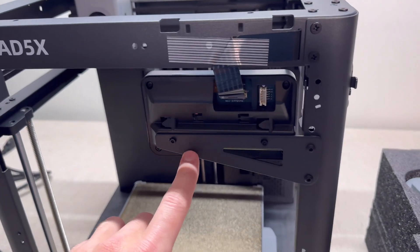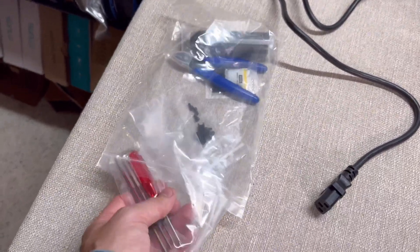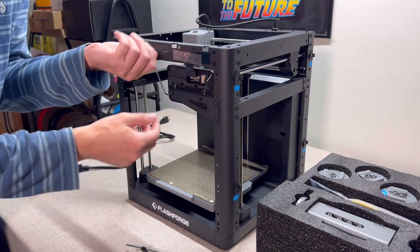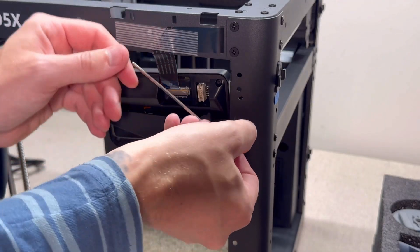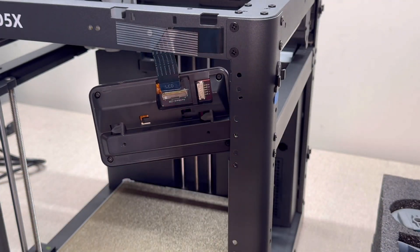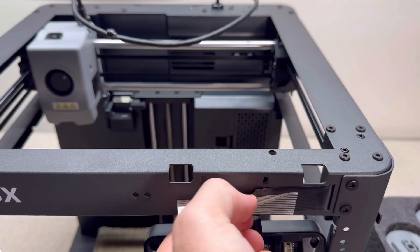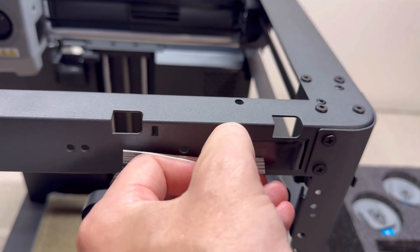Step number two: what we need to do here is remove the screws from this bracket. Go over to your Allen keys that are in your tool kit — they're in a small Ziploc baggie — and find which Allen key fits these screws. Remove the two screws that release the display. It's hard to see right now because the display is backwards, but it's actually the display. Then remove those side screws as well to completely remove that bracket. Next, you'll see a piece of tape holding back this ribbon. We need to gently remove this piece of tape — be very careful because this ribbon is somewhat fragile.